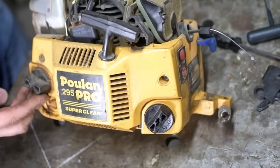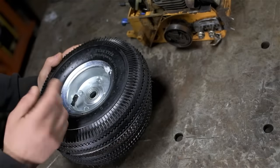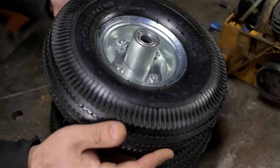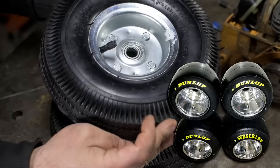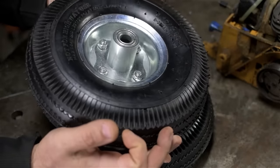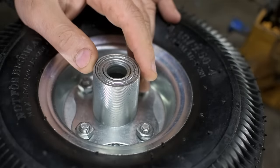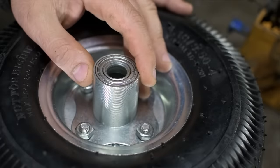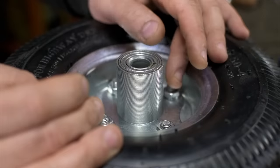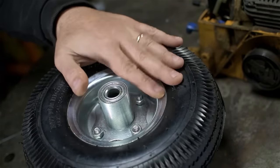It needs a little more cleaning, but that looks to be about it. For wheels, I had to go and buy these — I didn't just have them laying around. If you go look for go-kart wheels on eBay, you'll find very expensive racing wheels with Dunlop tires, and then you'll find these. These were about $15 import. The hubs and rims are thin pressed sheet metal. Although they might work okay in a cart situation, I don't know how much side loading they'd reliably take. I plan to reinforce these hubs, particularly for the drive wheels.